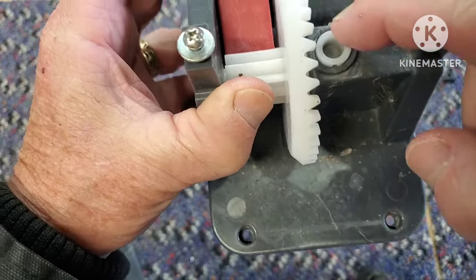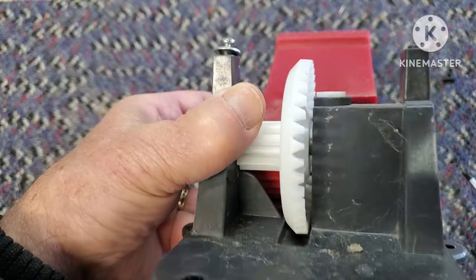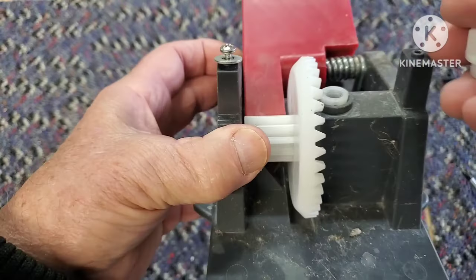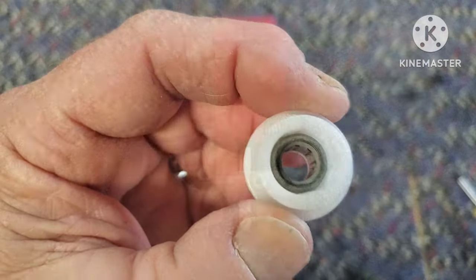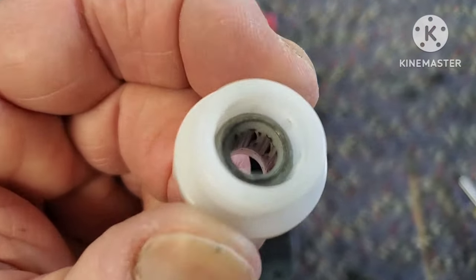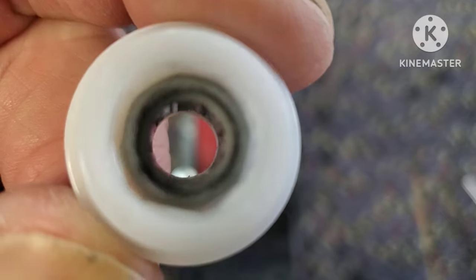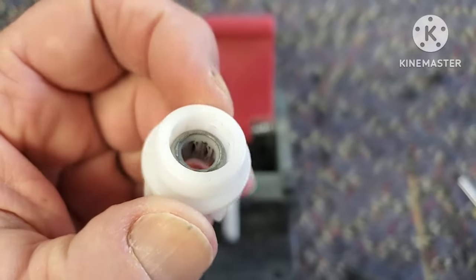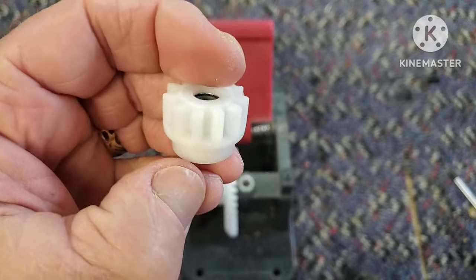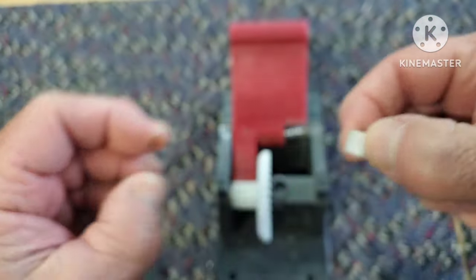You can pull that little gear off — it sits on a little sleeve that holds the bottom in place. That's what you need to get to: that little gear down inside there. It's a needle bearing that only spins one way, and that's usually what goes bad. You can get just the bearing itself and save the sprocket, that little gearbox. I just bought the whole thing — it's pretty cheap.